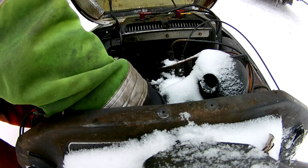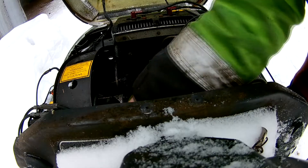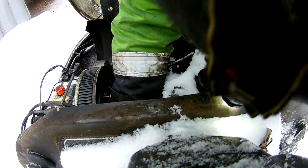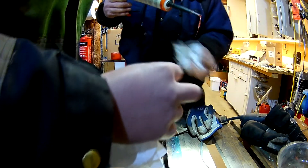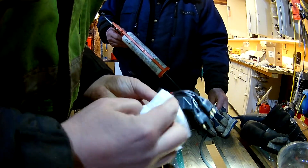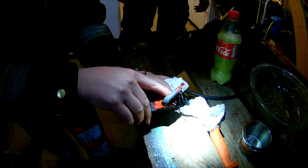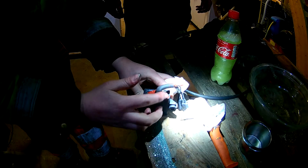We also noticed a hose crack going from the crankcase up to the fuel pump — it's a vacuum-operated fuel pump. The hose was almost cut all the way through; maybe it still allowed enough vacuum to help pump when the level is below the carb. Either way, I replaced it. We test-fired it and it started nicely after drying out the CDI. Then we added silicone to where the cables go in and over the crack, smoothed it with a wet finger.